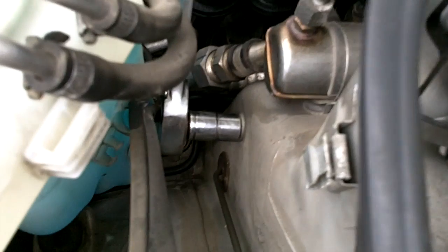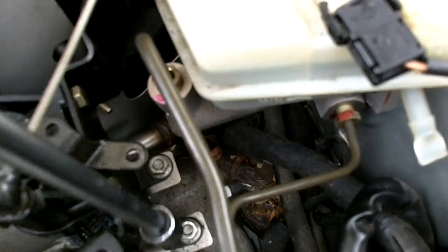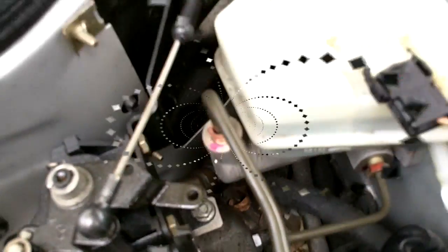Okay, once you've got the coolant tank off, it's actually a 15mm, not a 17. Wrench goes on there fine. Getting back in here is a little bit of a pain, so I figure the easiest is just to remove the throttle actuator. Again, excuse my sniffling. 3 10mm bolts. 1, 2, 3. Take those off so we can get to that bottom nut easier. I don't want to cram my hands in there, so I'll be back to you in a second.